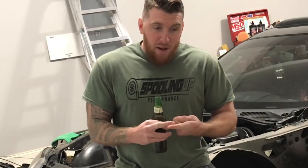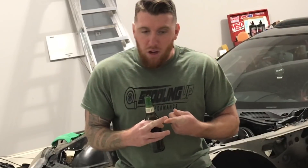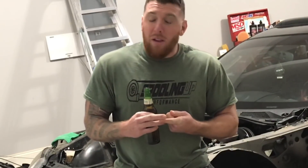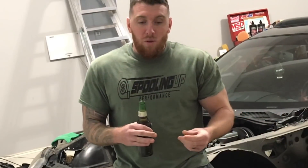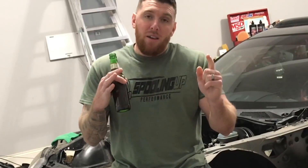There's a lot of things that are going to have to go into play here. I need to find a motor — it could be a low-compression motor that needs to be rebuilt. I'd really like to build it the way I want to. Those of you that know, the EcoBoost Mustang is a rear-wheel-drive vehicle and basically has a similar engine to the Mazda Speed. There are aftermarket motor mounts with a plate that mounts to the side of the Speed motor with four holes on each side. We'll buy aftermarket motor plates for an EcoBoost Mustang, bolt those up to the motor, and have mounts fabricated to the frame of the car.